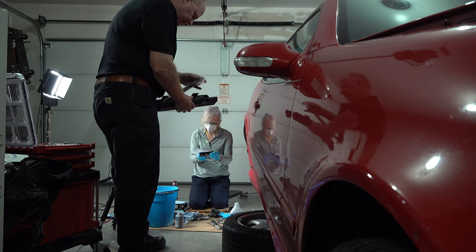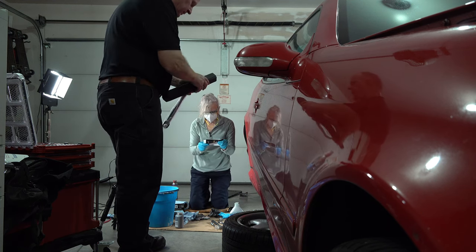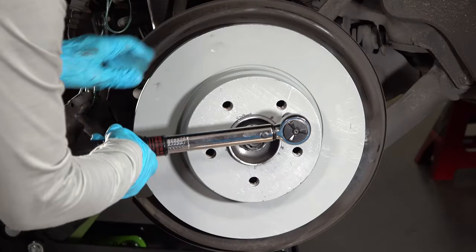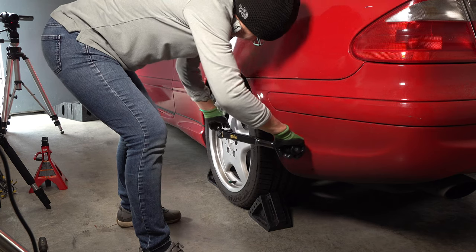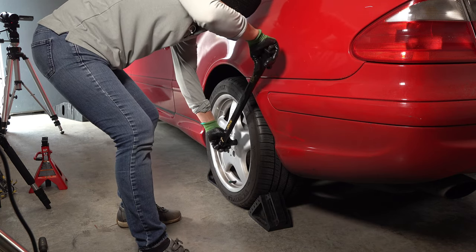I think we were missing a torque wrench. We were missing two torque wrenches. I bought a torque wrench for this job, but it only worked on the caliper bolt. When you buy a torque wrench, make sure it hits the whole span of all the bolts you're going to use — you had a tiny rotor lock nut requiring a tiny torque wrench, and wheel bolts requiring a large one.